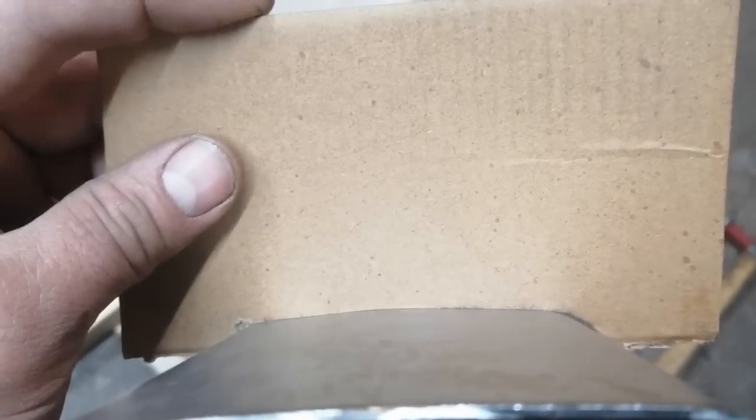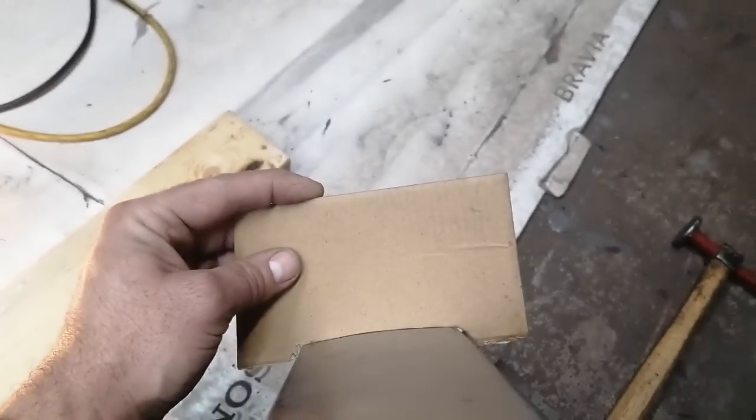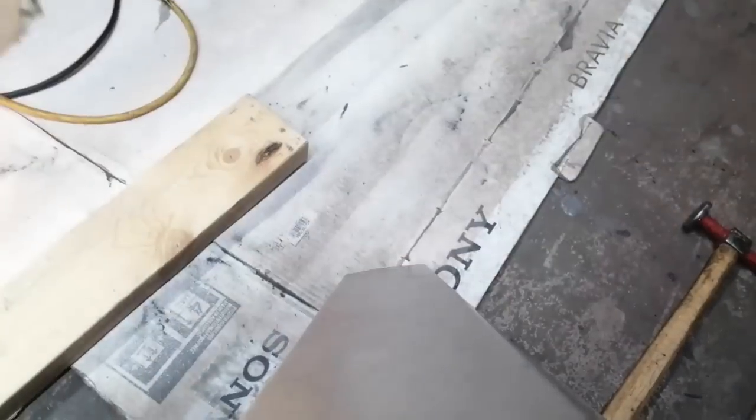Okay, so after a few minutes of hammering, I've managed to put a curve in that rocker panel, definitely within a 16th of an inch, so shouldn't have any problem. Now mudding that up. That looks pretty decent to me. Gotta love the template idea. It's kind of the first time that I've used this with Scott's tips and tricks along the way.